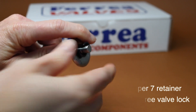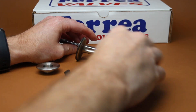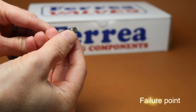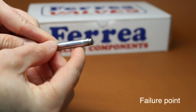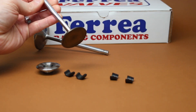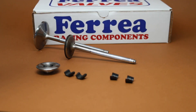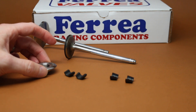That would be just catastrophic to the engine. I have a sample here of a customer's engine that actually failed in the groove area because the lock was put on there with the wrong retainer — and the lock was only one degree off. It ended up failing the groove area completely. It took off the tip area first of the valve, and then the lock was actually hanging in there. Believe it or not, he was able to shut it down completely, and it just tweaked the valve slightly on the exhaust side — he was able to save the engine. So it's very important to pick the right degree lock with the right degree retainer to avoid any catastrophic failure within the engine.